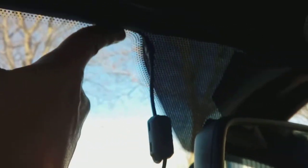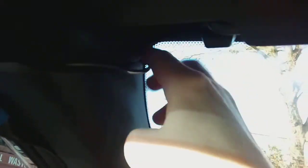Shove all three cable tie lugs under — up near the mirror, then the middle one, then the end one. When you get to the A-pillar, use your plastic leverage tool to pull the plastic trim slightly away so you've got a little gap around the edge. Tuck your cable in there and down around the corner. You only want it about a centimetre below — don't tuck it all the way down where the airbag is. Keep it so it looks factory flush when you put the trim back.